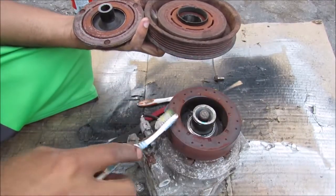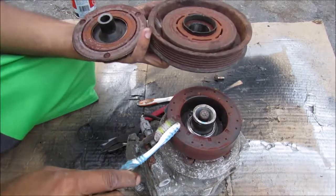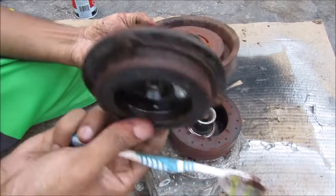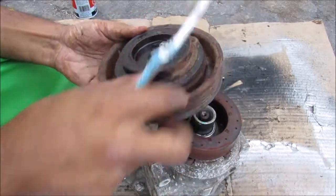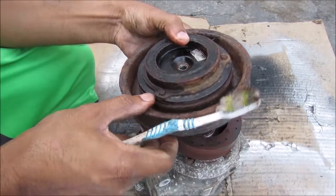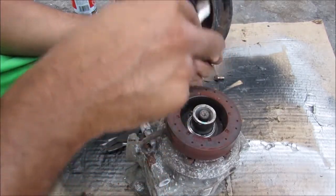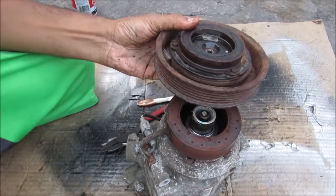Here you can see the electromagnet, which is powered by this wiring harness. This electromagnet does not need to rotate — that's because you've got your armature here. It'll actually sandwich itself to the free spinning pulley to rotate together as an assembly as the electromagnetic force sucks it through the free spinning pulley and together into a sandwich.